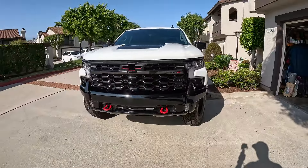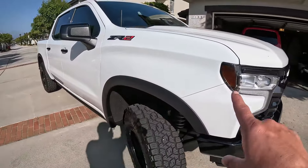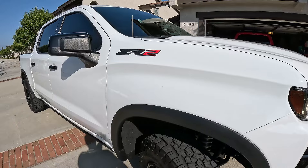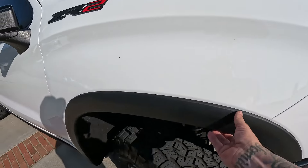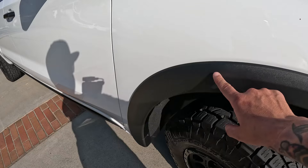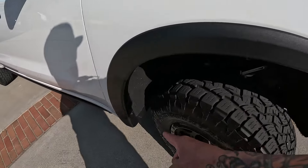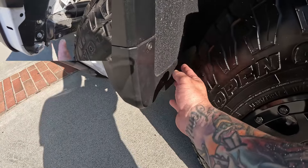I'll do my best to explain what happened - it's pretty much pull off the old stuff and put in the new stuff, not that hard. She's done. You've got pretty much all new fenders. You have to update your fenders - you cannot use the existing fenders off your truck. They have to be the ZR2 fenders because you're going to need this piece right here, and that basically snaps in with the holes right here. You're going to need to buy this piece which snaps right in.